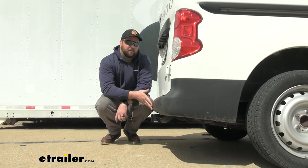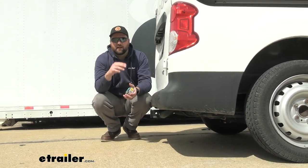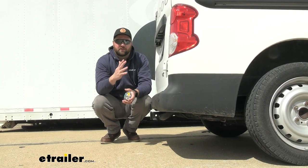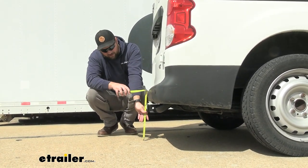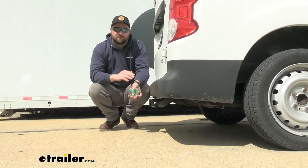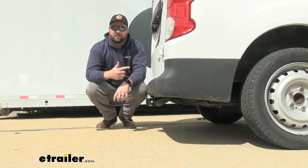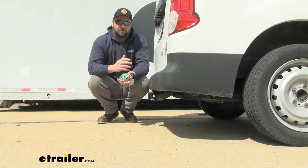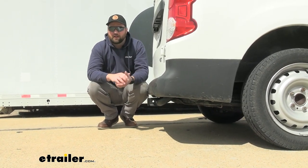Keep that in mind if you're looking for any accessories like a bike rack or a cargo carrier. With this hitch, typically if they're past the bumper, you should have no problems with any of those bike racks or cargo carriers folding up to the back of your car. From the ground to the top inside of the receiver tube is going to be about 12 inches — that's about the height that we recommend looking for accessories with a rise in the shank. This particular owner is going to use it to tow a small trailer for his irrigation business, so it's going to work out great for him.